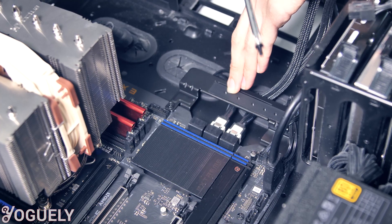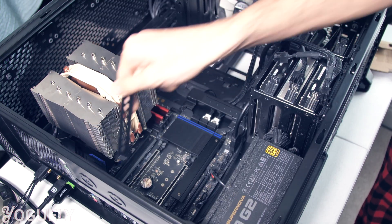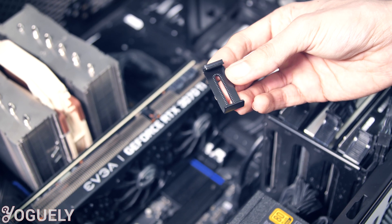Place the bracket here on the motherboard and attach it using the two screws. Next, remove the port slot where the video card ports would go. Then put down the clip, take the graphics card and install it. Finally, you're going to install the bracket that's going to prevent the graphics card from sagging.